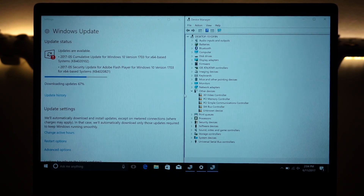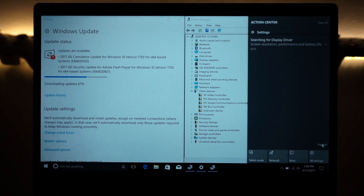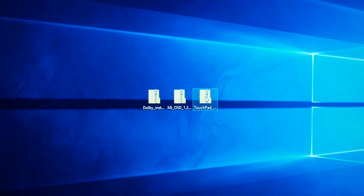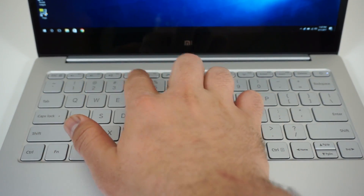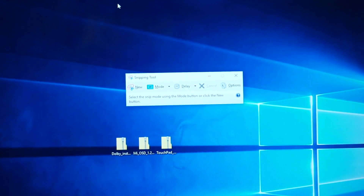It's flashing now, which means it's installing the drivers — you can see things refreshing. The laptop went into different brightness settings so let's push it back up. Once Windows updates finish, there are three drivers you want to install. First is the Dolby installer, which provides an equalizer with presets for different sound types — optional but useful. Second is the touchpad Synaptics driver, which enables touchpad gestures like horizontal and vertical scrolling and two-finger right-click. Third is the Mi OSD, or Mi UI on-screen display shortcuts — the screenshot and snapping tools won't work without this program.